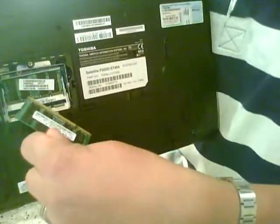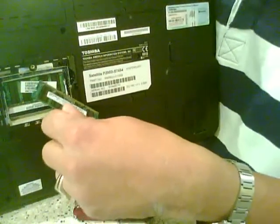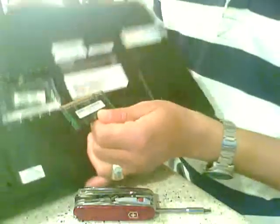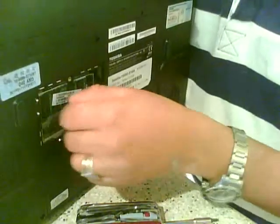As you can see, it uses one gigabyte on each slot. I think that's the maximum you can take — one gigabyte PC2-5300S. So if you want to remove it, you can remove it that way. And if you want to put it back, put it back like this.